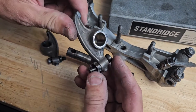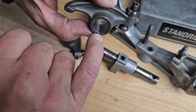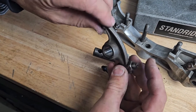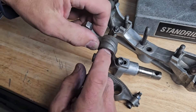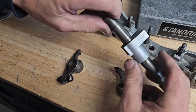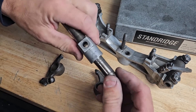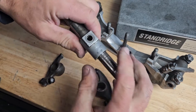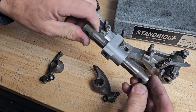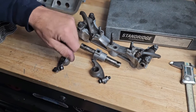These rockers do not have any bushings in them, and we can see wear in the bottom of the rocker. We have a company that rebuilds these — they oversize the inside of the rocker and hard chrome and centerless grind the rocker shafts to make up for the clearance. That does mean we have to ream the center support bushing, but it's a pretty straightforward operation.